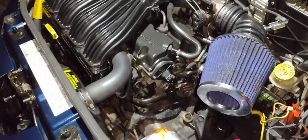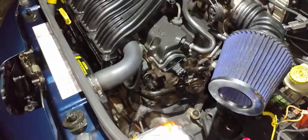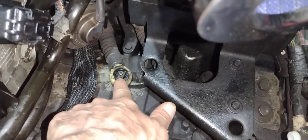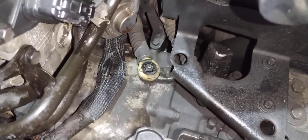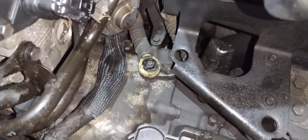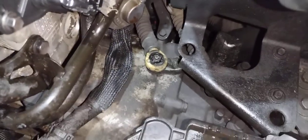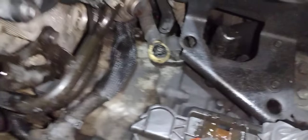After that, I still haven't changed the oil yet but I'll do that later. Another thing I have to do is this transmission portion right over here — see these are the plastic bushings and they're already starting to deteriorate. They've been on there for less than 500 miles, maybe a thousand, and already we've got deterioration. They were installed less than two years ago, but just the time in plastic it's already deteriorated. I have the polyurethane bushings, so I'll be installing those soon — that one and that one here, and then the ones on the inside of the cabin.